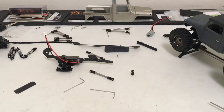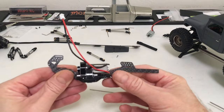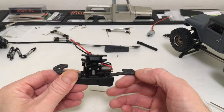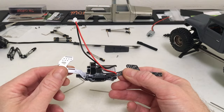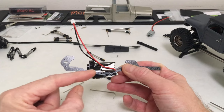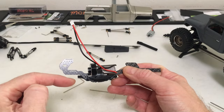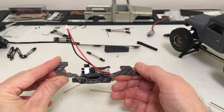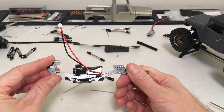So that was the process. Now that we got a little 30 weight in those shocks, I've got the frame torn apart and I'm looking at some fitment here. So you can see I've got it facing the rearward, typical position here. So I looked at it forward facing, and because this skid slopes, it ends up putting that long can pretty low in the front. And so that potentially is going to really hinder the upper link travel.